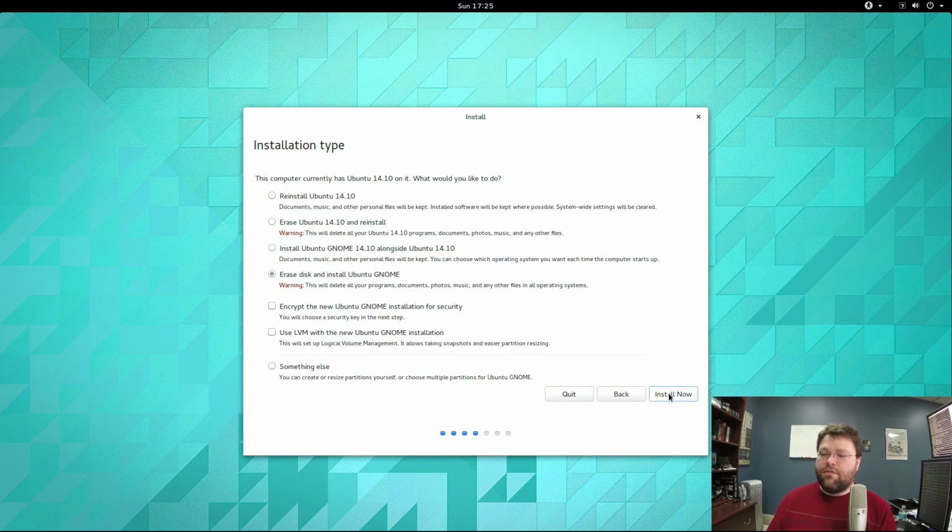And so, if you have a 500 gig disk and you think, oh, that's not enough, I need another 500 gigs, you can use LVM to make the partition span both disks. It's not RAID, it just gets to the end of the disk and then goes to the next disk. It's not RAID 0, it's not RAID 1, it's not RAID anything. It's maybe close to JBOD, just a bunch of disks. So LVM can be kind of handy, but